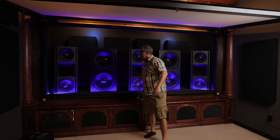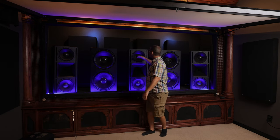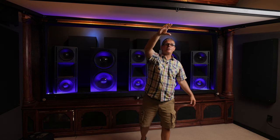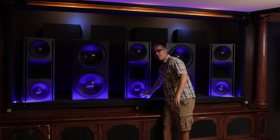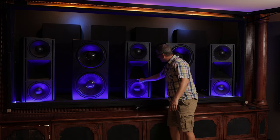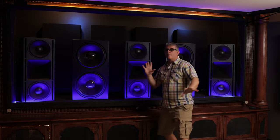Some things I've learned over the years: you may or may not want to put your speakers on a platform. If you've got tower speakers, do not do this — it's going to put your tweeter way up high, and because tweeters are very directional, the sound will travel above your head. An MTM configuration — woofer, tweeter/midrange, woofer — works really well here because my ears are right at the bottom of the tweeter, and with some vertical dispersion the sound reaches ear level when I'm sitting in the chair.